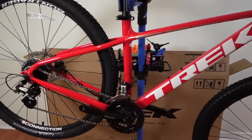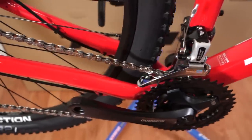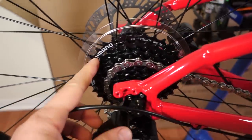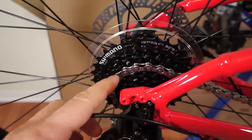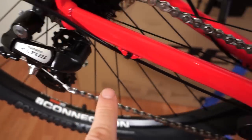Here's the bike ready to go! It was a fun job and it didn't take me that long, mostly because the drivetrain was pretty much ready to go with very little adjustment. This is a 3x8 — so 8 speed in the back, 11x32 I believe, with an Altus rear derailleur.